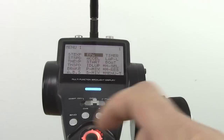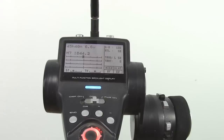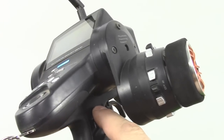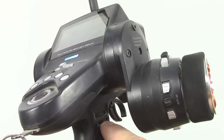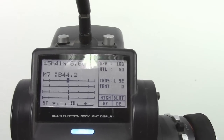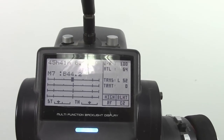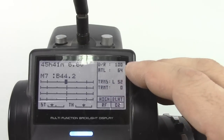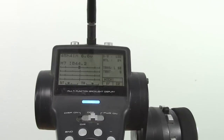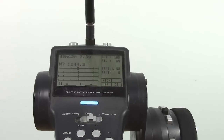I set my brake at 100 on the radio but I use something called ATL — Adjustable Throttle Limiting — and on electric vehicles that's only for the brake side. I have a little dial down here; the top one is dual rate and the bottom one is ATL. I can leave my brake at 100 and adjust it on the fly with the ATL dial — so technically that's 50%, 58%, 64%, wherever I want it. Dual rate: once you set your endpoints and have everything going lock left and lock right, dual rate just lets you use a percentage of that steering. If dual rate is at 100, the wheels turn lock to lock; if dual rate is at 90, the steering will only turn 90% left and right.